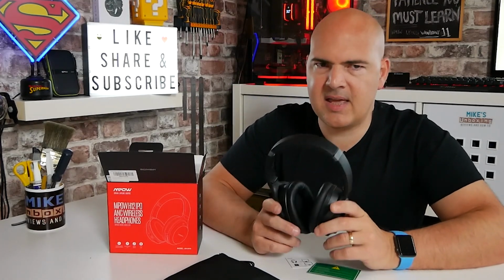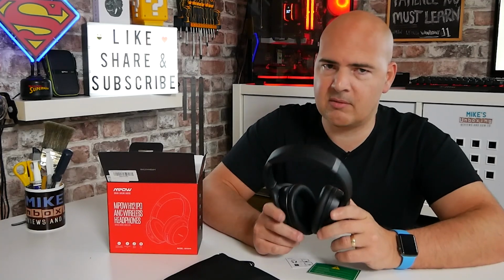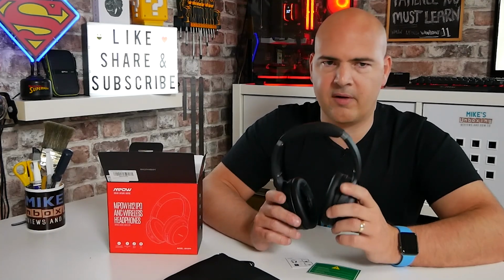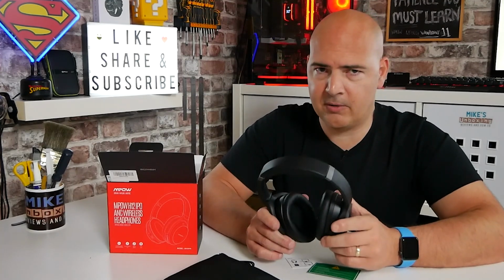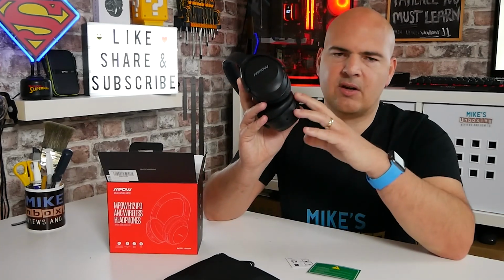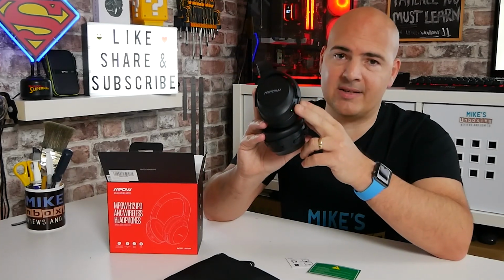Now, there are some drawbacks of this particular setup. Because the microphone is basically working through the Bluetooth system, like I said earlier with the TRS thing, you cannot use the microphone when it's in the 3.5mm jack mode. Also, when you're using the 3.5mm jack, because it's kind of unpowered, you can't use the ANC.